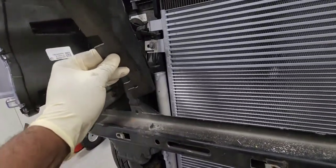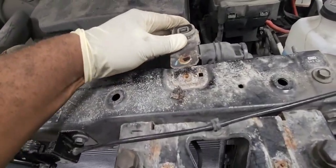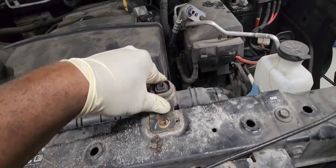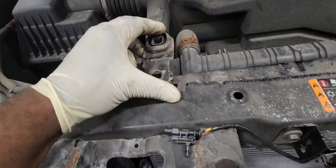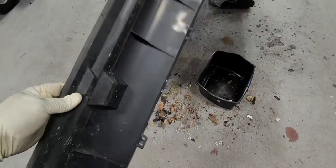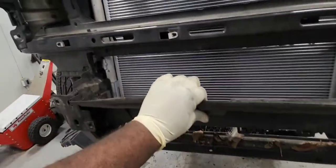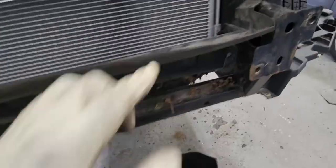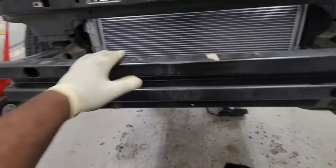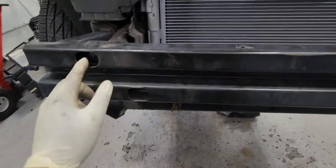Let's put our air baffle in with the other bracket. It's pretty much the reverse of removal. It's pretty easy. Let's put them back in. Doing the lower baffle now. It's clipped to the radiator, by the way, at the bottom part. Our bumper reinforcer is in, 4 15 millimeter.